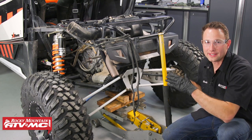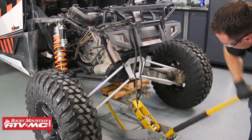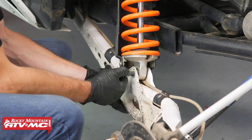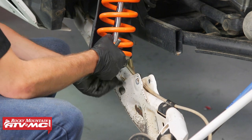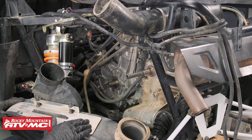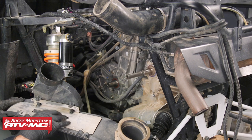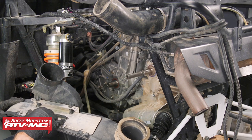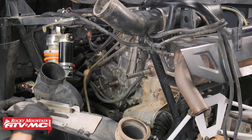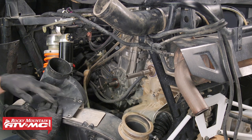At this point we're ready to reinstall the clutch components. To do that we're going to raise the rear of the machine, remove the left rear tire and that lower mount on the rear shock, so we're going to have clear easy access to all the components. We're ready to put this inner cover onto the machine — the main thing to keep in mind is the fuel lines are going to run on that inner channel. On the outer channel you've got your battery cables, throttle cable, and a vent tube from the gas tank. We'll cover it up and there are four rivets that go in it.